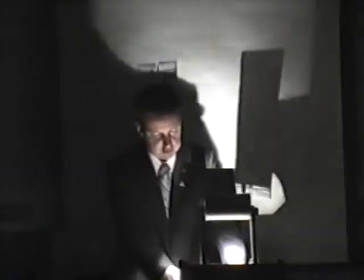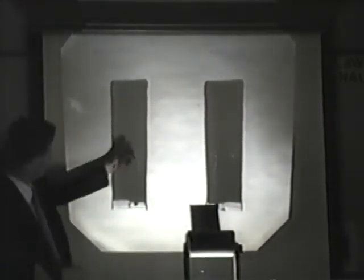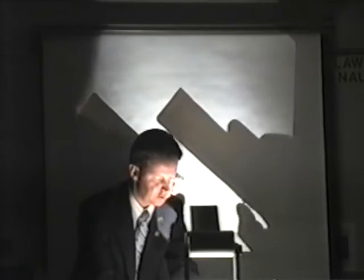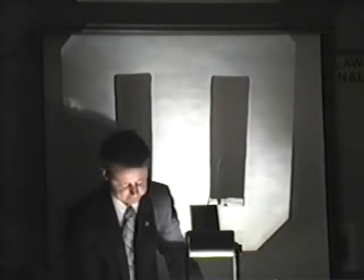This is an example to simulate what I'm talking about. Supposing these are the two front tires. Now you can see the distance between those two tires, center to center here. As I turn the tires, the more I turn them, you can see the space between them narrows. And as I turn it back, it widens. So that's basically what's happening to the track system. That's why, when a vehicle is making a turn, you cannot measure across at right angles.